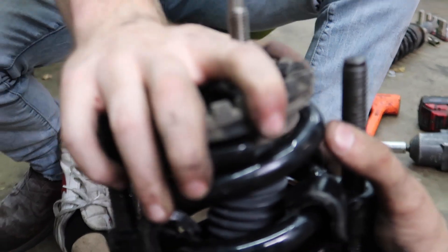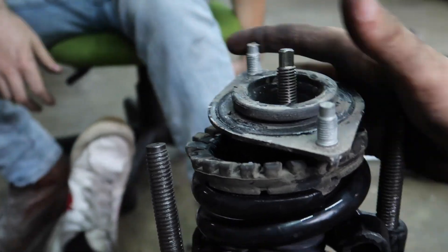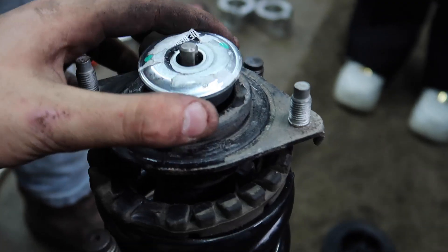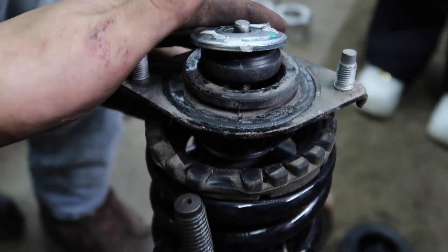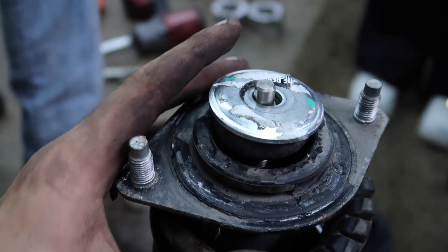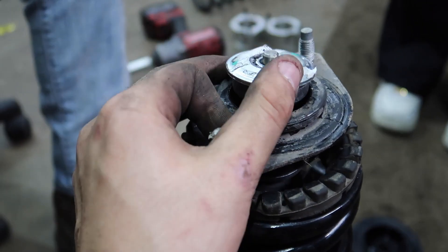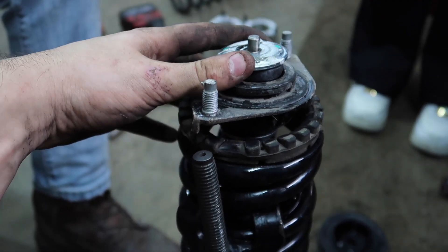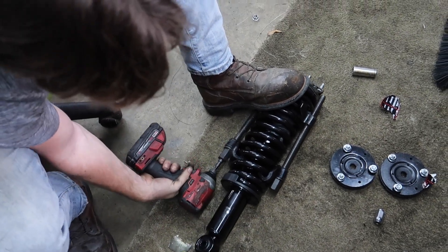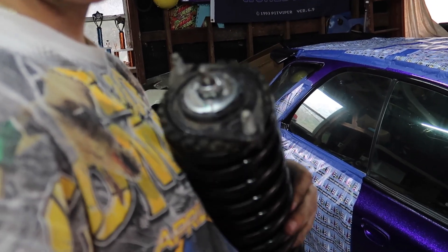That part goes in like that, and that piece goes on top — kind of slides in there too. Rubber bushing, then the washer, and you want these to be perpendicular to each other, so that one's sideways and you want this one to be facing that direction. You can twist it a little bit in the car so it's not 100%, but if you can do it right the first time you might as well. And then this right here is the finished product — Toyota Tacoma shock with Subaru Baja strut top.